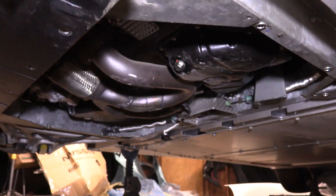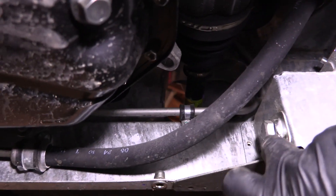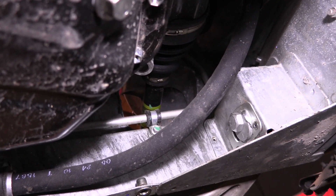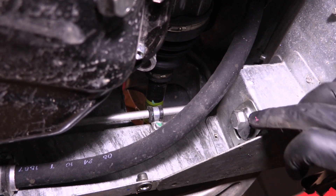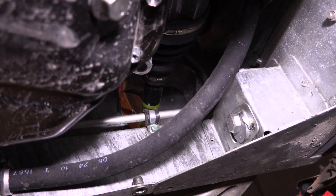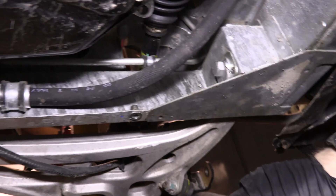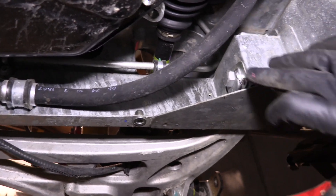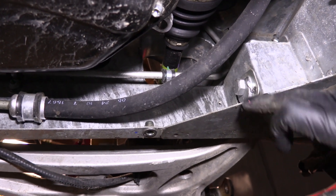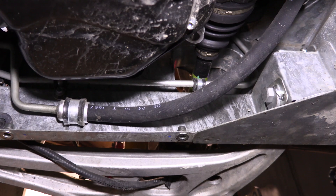Now comes the hard part. Let me bring you to the other side. Now we're on the other side of where that bolt comes in — you can kind of just see it right there. You can kind of see what it looks like when that bolt's just smashed that little metal plate. And that's it — that's our problem right there. This bolt needs to be loosened up and adjusted so this washer can slide down. These plates need to be replaced so they're not all smashed and letting the bolt slide back. That's our half inch that we were talking about earlier. That'll slide this lower control arm out half an inch and get us back in alignment. Overall it's really great that it's just this stupid little plate — the subframe is straight and flush at a 90 degree angle. We'll be drilling these out, popping them off, and figuring out how to make or order new ones.